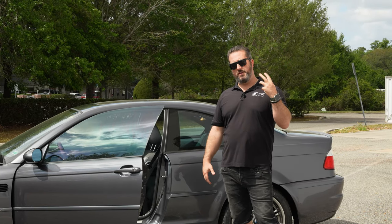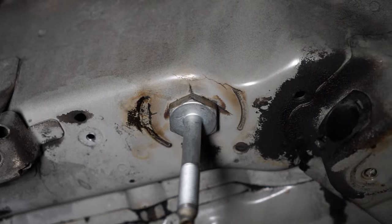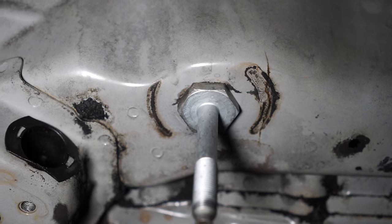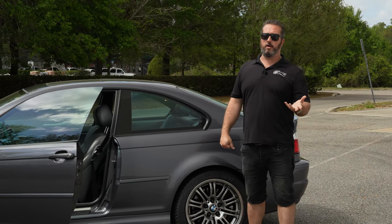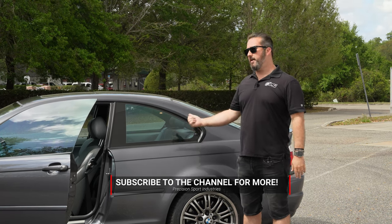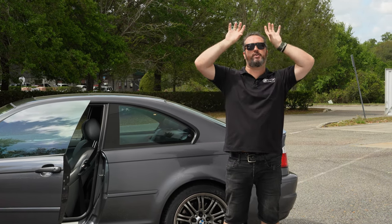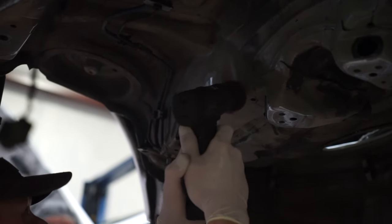The other stuff I'll touch on with these cars is the subframe. The subframes tear in these cars because of the way the subframe mounts — they have vertical bolts that mount into the chassis, and the chassis is horizontal, so they flex and crack. It's on every single one that we work on. The worst thing I hear is someone say they bought the car and the guy said he did a subframe inspection and the subframe is good. You can't really do a subframe inspection — you can shine a light and see if it's really bad and the cracks have passed the subframe, but the physical subframe actually blocks access to see the damage on the body. Subframe reinforcement is something we do here a lot — we have our own plates, standard plates, and we've done Evan's bars before, though that's kind of crazy and extreme.